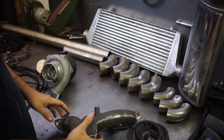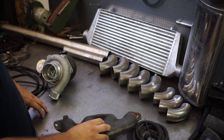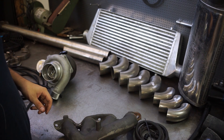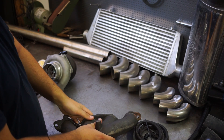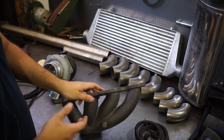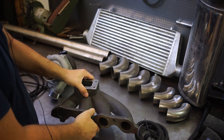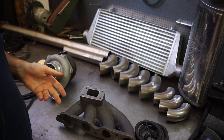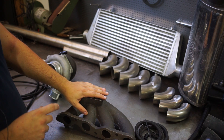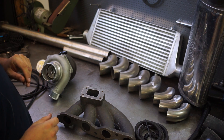While this will increase exhaust gas temperatures and the general temperature of the components, it is very important in this case because the manifold is very close to the radiator and also close to some other peripherals that really don't like the heat. This manifold is not really a log style — it's more like a combination of a cast and tubular manifold, so it should flow pretty well, at least better than a DIY log style. It is a top mount, so we are going to have some space issues, but I already test fitted it and it should work. We'll have to modify the coolant line somewhat but that's not a big issue.